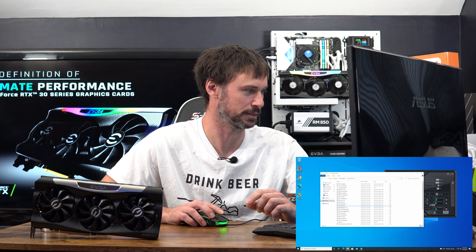The 3070 is installed. In AfterBurner, I'm not going to touch the core clock or memory clock right now, but I'll set my fan to 60% and my power limit to 70. I'm doing that for temperature reasons — I don't want to run all the juice to it right out of the gate. Let's go ahead and open up T-Rex and get the miner going. I'll use Ethermine and we'll see if it's an LHR card.